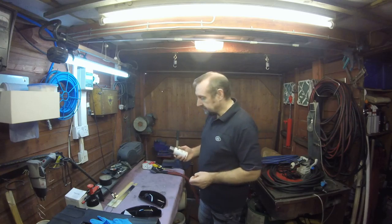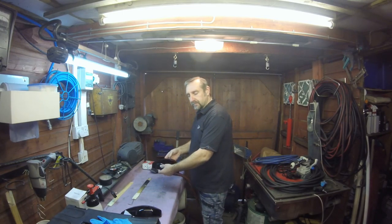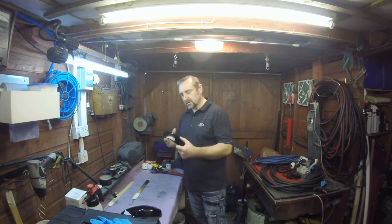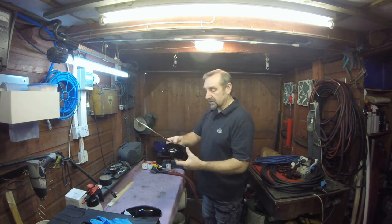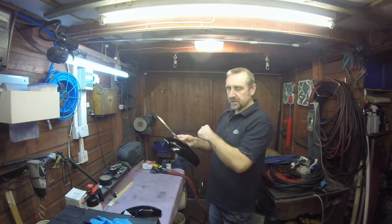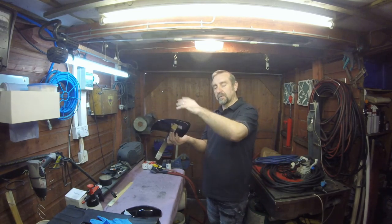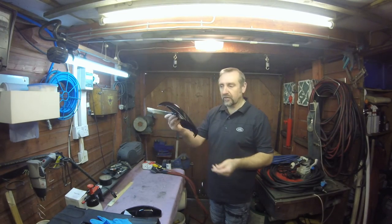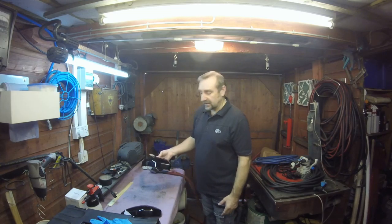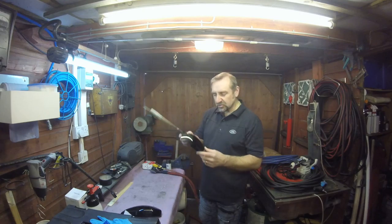The second video will also show you how to mount the mirrors onto what I call lollipops. I don't like putting things on masking paper or a tin of paint and trying to get around to paint them — there's a good risk of blowing things off, you can't get the underside, it's not flexible enough. I prefer to mount on a lollipop so you can see your finish and paint every surface on a flat surface rather than on edges. If something goes wrong at the clear lacquer stage — a fat edge building up — you've got the option of mounting it a different way up so the paint flows back where it needs to be. If something's on a drum and you see a run starting, you have to leave it or risk a thumbprint in your wet part and ruin the whole job.